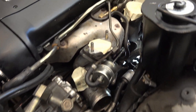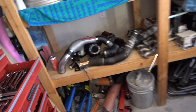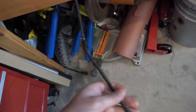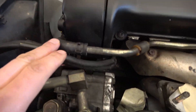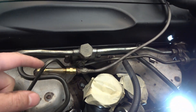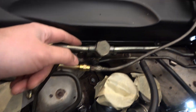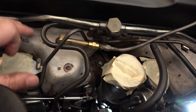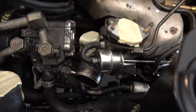We're roughly about an hour in. It took me about 30 minutes to remove the downpipe and disconnect the exhaust sensor. Now I'm going to remove this upper line first - that'll give us access to get down here a little easier. Then we can work all this stuff out and start taking off the exhaust manifold covers, working top to bottom.